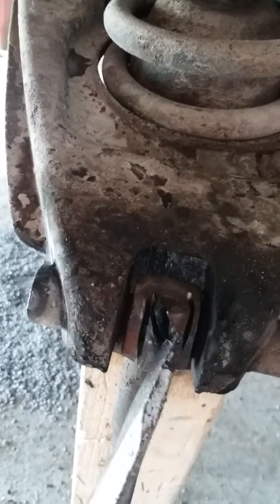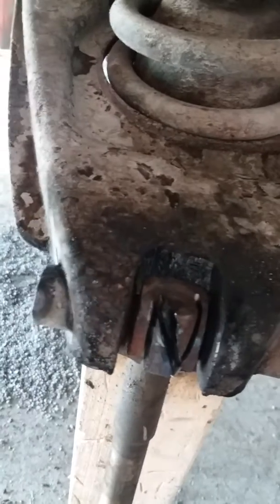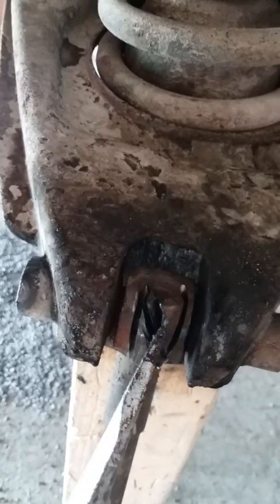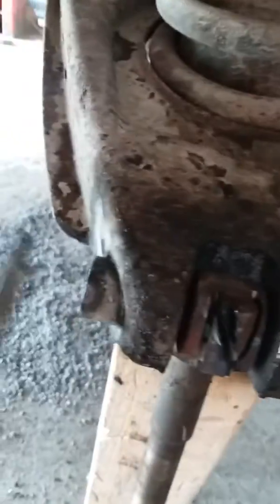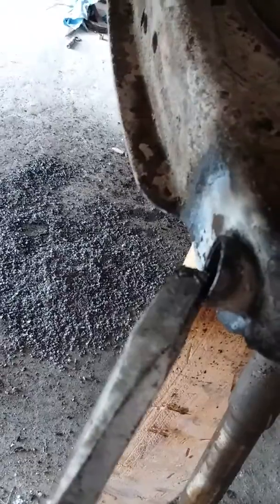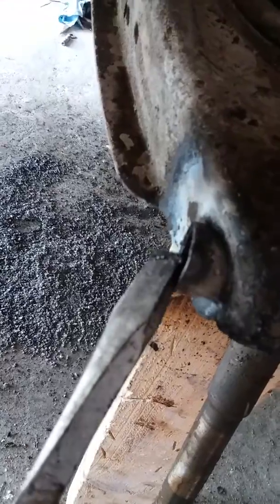Just cut this out and hammer it out, and it'll come out, it'll fall off, and then you screw the fulcrum pin out. That's going to save you 15 bucks. You won't have to buy a fulcrum pin. You won't have to buy all the nonsense. As far as grease dirt, you can just most likely thread a smaller one into the end of that fulcrum pin, and then use some duct seal and just pack it, and it should be just fine.